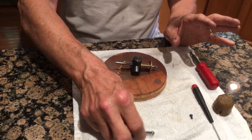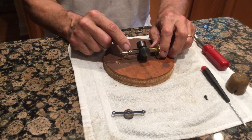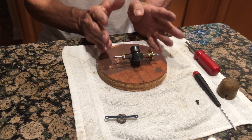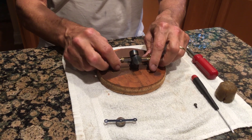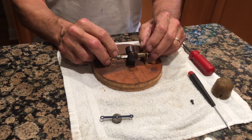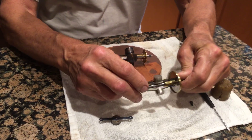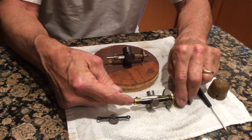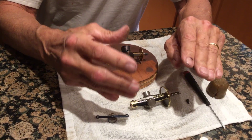So after you get it apart, and you get this back ring that has a set screw set, and everything's loose — that's where you want to have it. After it's all tightened together, you can undo the little set screw here and you can adjust it. Some of them, like the B-801, have a built-in adjustment, and in here they had a slot carved into the Governor's shaft where to mount this ring — some of them have this, some of them don't.